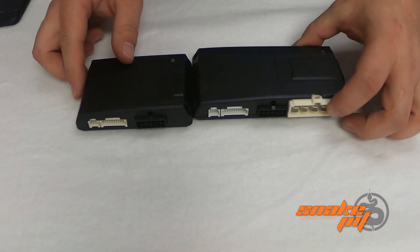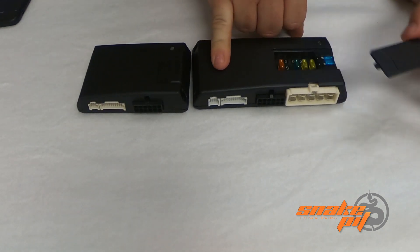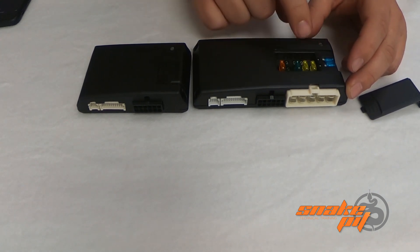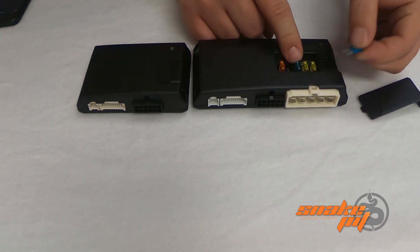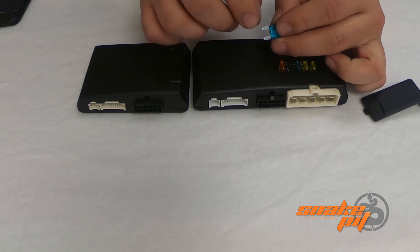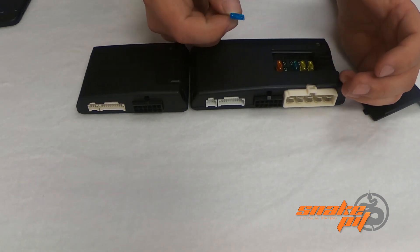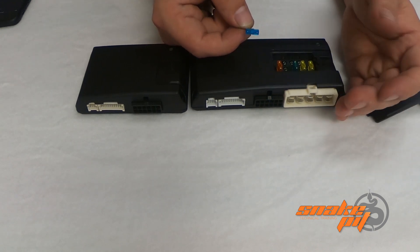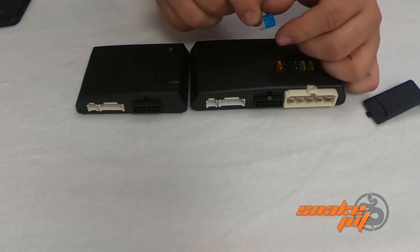On the tops of the modules, we have our fuses all on board now. If we pop this little door off, we have our high current fuses — our main ignition, our flex relay, the pink white, and our starter accessory circuit fuse. Then we have our relay three fuse. We're going to talk about this in serious detail because it's a really cool feature of the DS system. We can actually use relay three not only for parking lights, but for other things like second starter and other outputs. So pay close attention to this fuse.